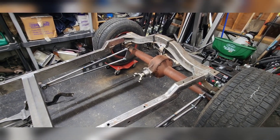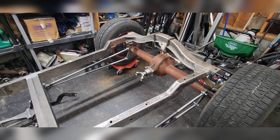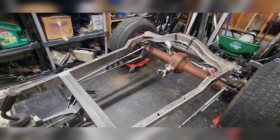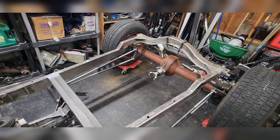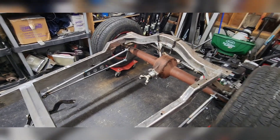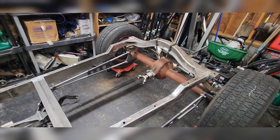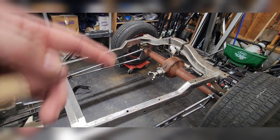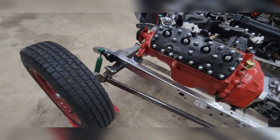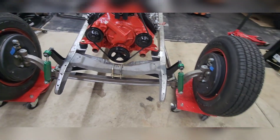It has a reverse eye drop spring in the rear with every other leaf removed. I have a feeling I might have to add a couple springs, but we'll have to see once we get this thing all put together — see how it goes over bumps and if we bottom out. I'm obviously gonna have to shorten those U-bolts once I get the threads extended on them; I'll cut them back so they don't hit the pumpkin back there.